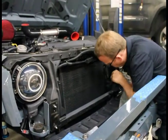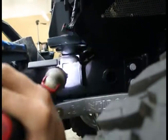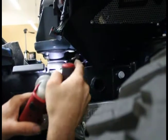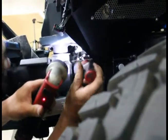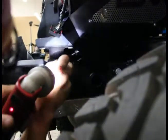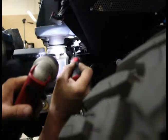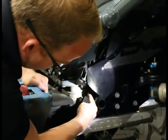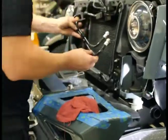This just goes around down the bottom there and connects to the jiffy-tight type fittings. So we're underneath here by the driver's side headlight, right around where the radiator's at — this is where we're going to disconnect the factory transmission cooler lines, and this is also where we're going to reconnect. To get the lines out that we're removing, we're going to remove this 8mm bolt here, push these two pieces back, and remove the retainers for the jiffy-tight clips. I took the one 8mm bolt out, undid both of the clips for the trans-cooler lines, and now I just need to pull out the pipe here.